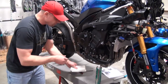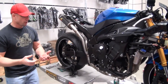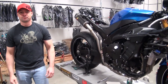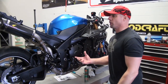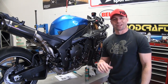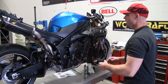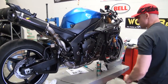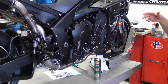That part's done. I'm going to mount the rear setup, and then we're going to go ahead and run the bike. What we want to do is take the opportunity to check for leaks before we put all of our bodywork back on. Everything's mounted up, everything's tight, we are good to go. Before we put the bodywork back on the motorcycle — and this especially holds true if it's stock bodywork because that is a project — we want to run the bike and double check that everything is cool. The areas I would focus on are where we've got a gasket that we reused, and all along the header where it meets the cylinder head.